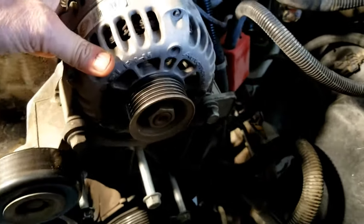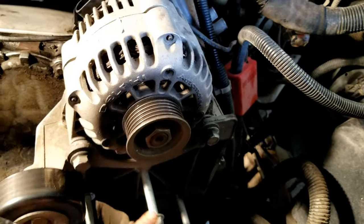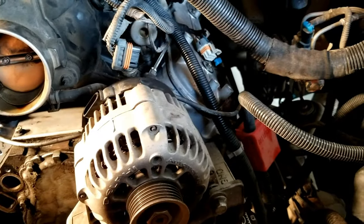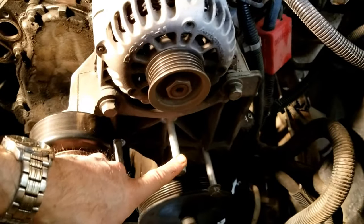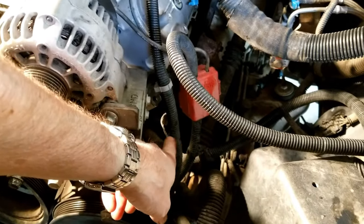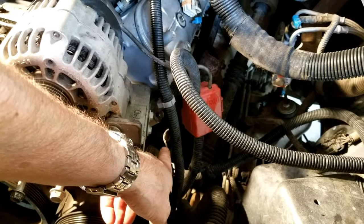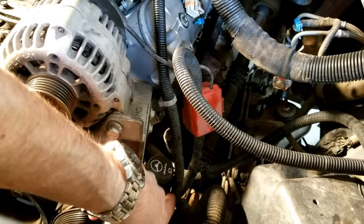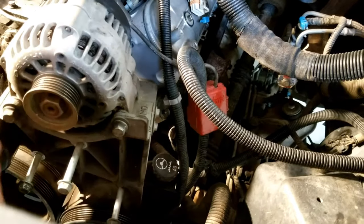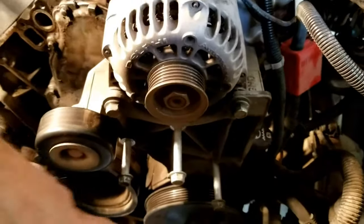This assembly here, I took that off, actually, because I had to, because it bolts into that head up there. But it's probably good to take this off, too, because you've got to access a little Allen bolt plug over here that you have to access to prime the oil pump. So I'll show you how to do that when we get to that.